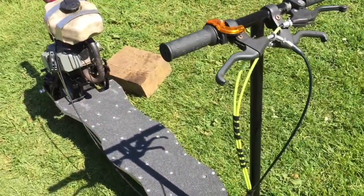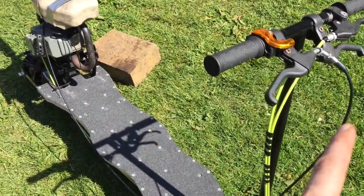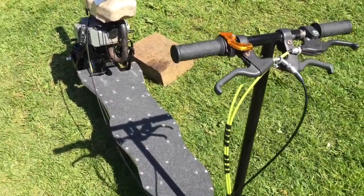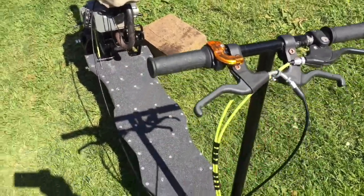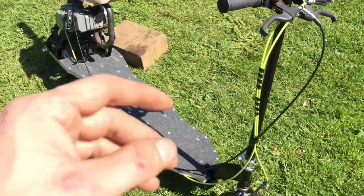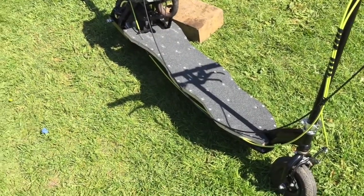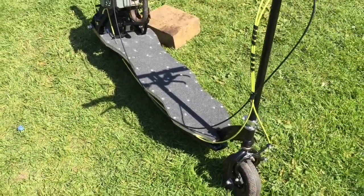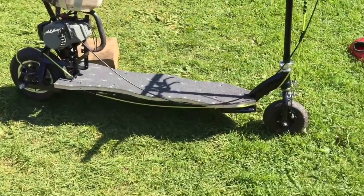Yeah, I'll get some silver solder and then I'll just get a massive brake cable and make a throttle cable out of it, because there doesn't seem to be any to fit the length. The ones long enough to fit the scooter have different connections on them for different types of engines, so nightmare. Some have a lot more wire sticking out of the cable part, so the cable cover for bigger carbs and places it needs to reach for specific vehicles was no good for this. So yeah, that's where it's at just now.